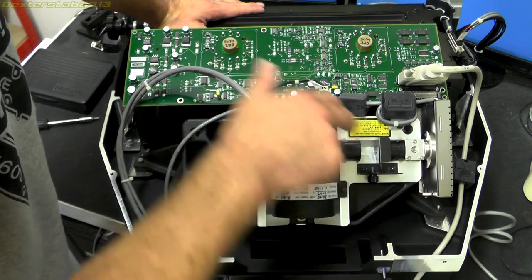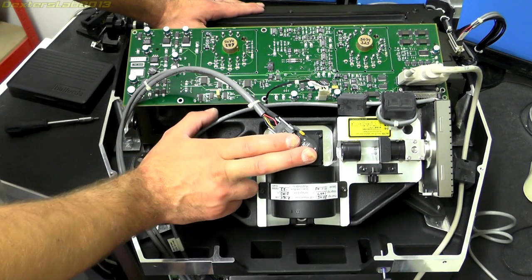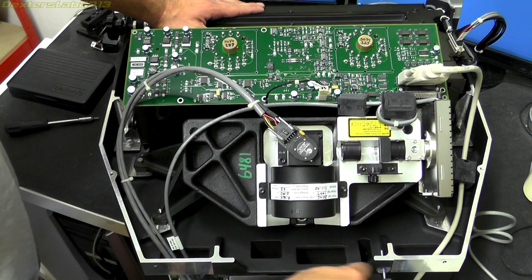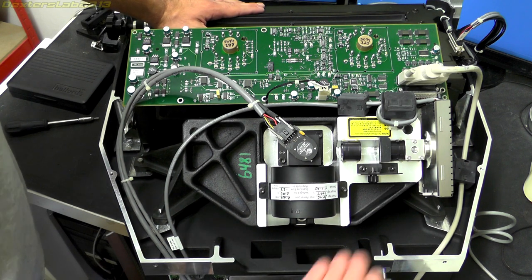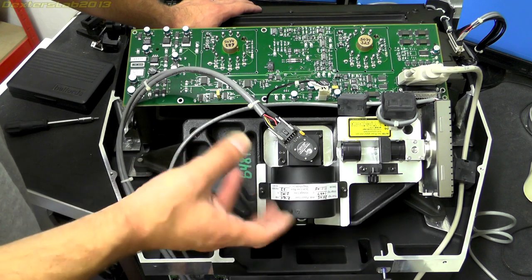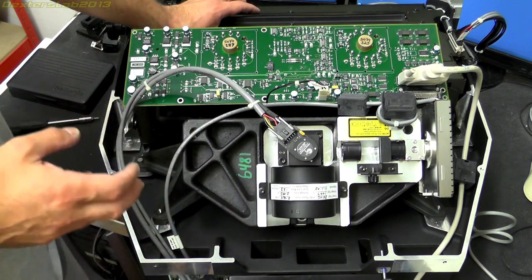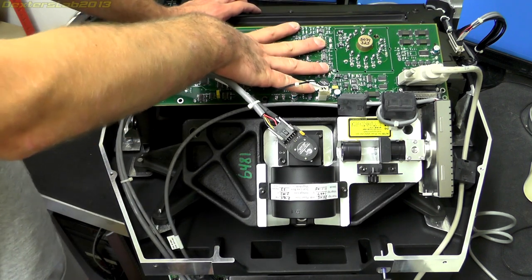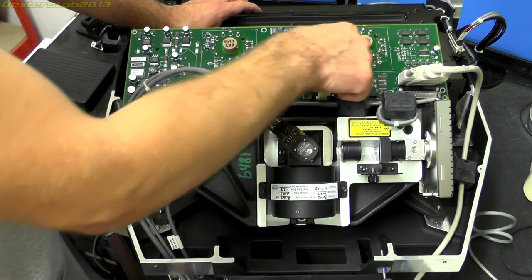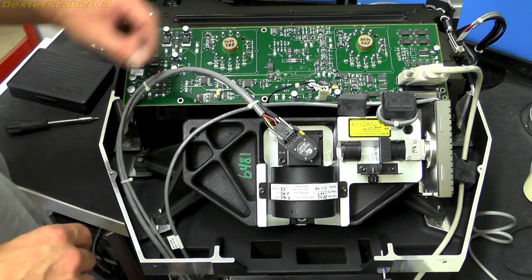So that travels into this unit here, and this part here - this is a galvo. This is essentially just a motor with a mirror on, and it basically creates the scan. So out of this lens here you have a scan which is going backwards and forwards, which is then reflected by this mirror down and onto the imaging plate. The imaging plate, when it's actually hit by the red laser, it exposes or allows you to see the image that was exposed on it originally. But it comes out as blue light. So that is then picked up by two large photomultipliers. I can see the large socket arrangements here - those are for some pretty big photomultipliers. Why there's two, I'm not entirely sure. There's obviously a good reason for that - hopefully we'll find out when we get into that section.